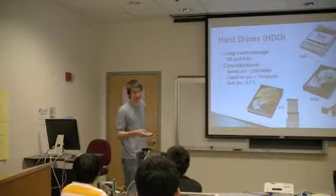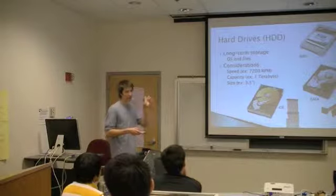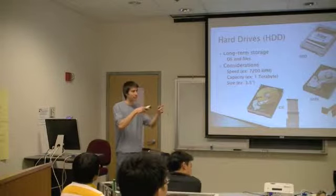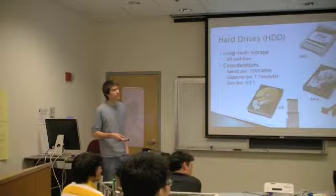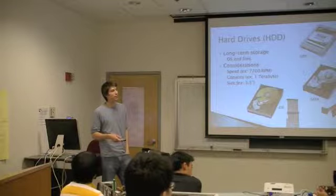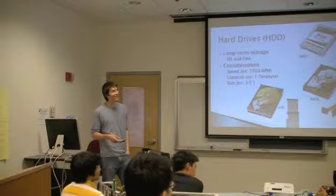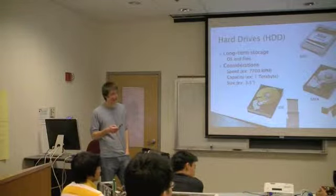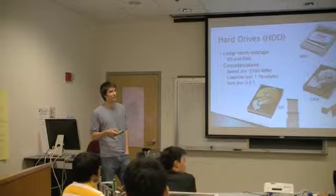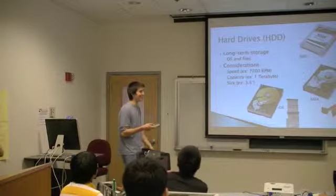Yeah, I mean, look on Slick Deals. I'm serious. The size. For desktops, we're talking about 3.5-inch. Notebook drive like this, for example, is going to be 2.5-inch. So, yeah. Can I interject a little warning here? My MacBook, I actually got a 1 terabyte drive that was 2.5 inches. Apparently, my MacBook only fits a 9.5 millimeter tall drive. So it was a 12.5 millimeter tall drive and wouldn't fit in. And they were telling me it would. And I was like, I don't think it's going to fit. But so you do sometimes have to pay attention to the height, too, if you're working with a smaller notebook. That's a good point. I've never had that problem, but leave it to Apple to use a different small.